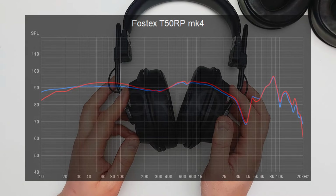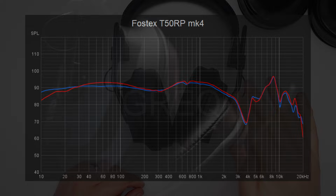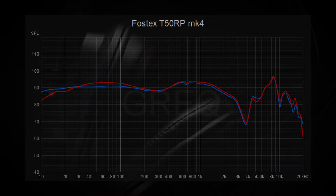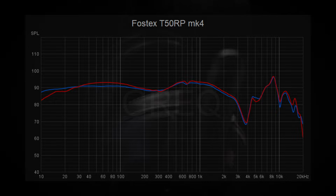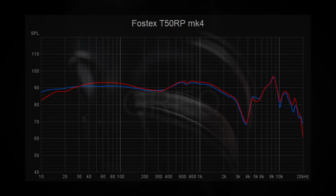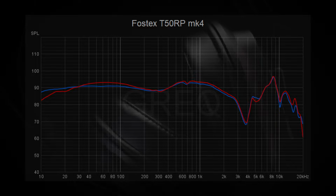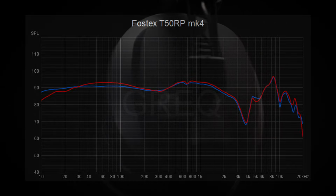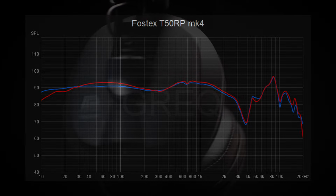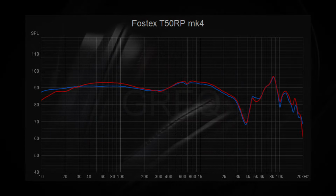The left channel has an almost linear response, while the right channel has more of a mid-bass hump with more roll-off. While performing tone sweeps, the right channel does appear louder, but the left driver continues to move at lower sub-bass frequencies. The good news is that neither sounds subjectively bad, but it's possible that others may end up with more linear and bass lighter sounding units, and others may have bassier units with less sub-bass rumble and texture.